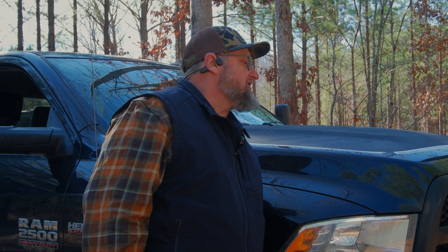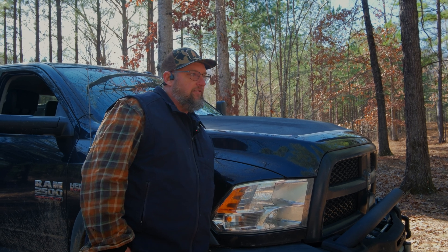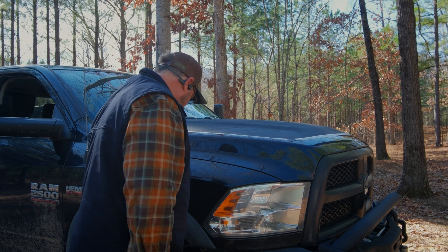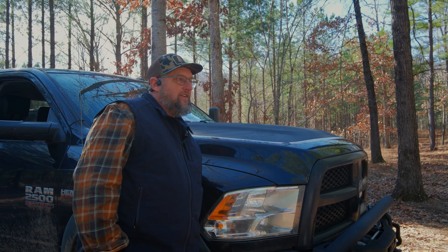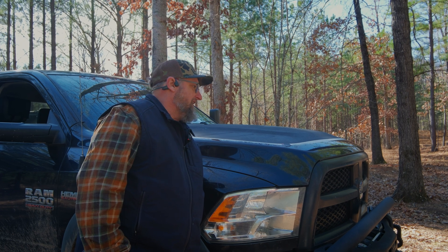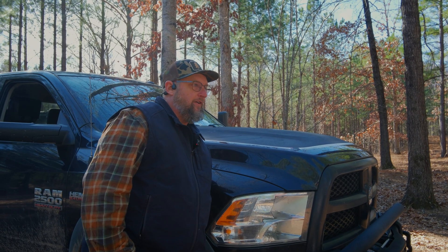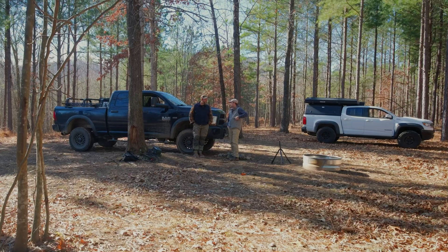The other thing is, you start looking at the skinniest tire you can get with the heaviest sidewall you can get — they'll just stand up with not much weight in them. It takes some weight to flatten them out. This truck obviously has a little more weight and flattens them out a little better, but if you were in the woods you'd probably have to take this down to 20 or 18 to really make an impact. In the sand it probably helps some on the lighter truck with heavy sidewall tires, but most of the time you've got a whole lot of tire under not a lot of truck, and it's not near as much benefit as people think it is.